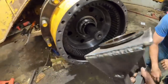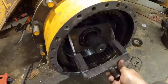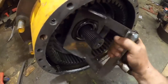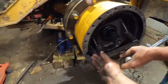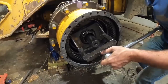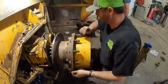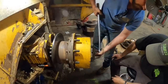All right, nuts next. You want to grab that torque wrench? It's kind of hard to start while you're holding this big old ginormous tool and trying to film it. All right, first torque to set everything. It's like 350. What are you set at? There we go. Now we gotta turn it 5 times, back it off, and retorque it. How far you wanna back it off? Half turn, it says.